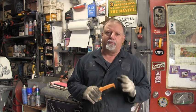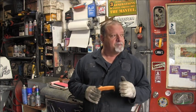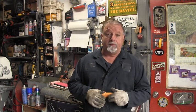Wrapped up on that 25. That motor has a lot of issues. It doesn't shift really smooth, and that's because the motor mounts, they're not broke, but they're just worn out, so the whole power head kind of shakes around, and that'll cause that hard shifting. But it's a really hard worked motor anyway, but it seems to be cooling fine. We put a new water pump impeller in there anyway because the customer requested that, so I did that.